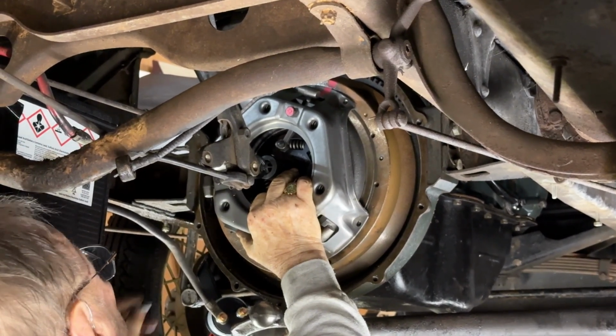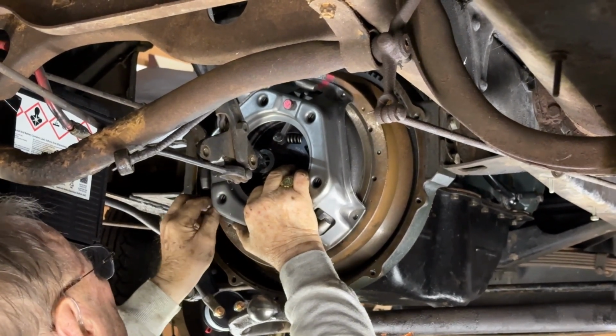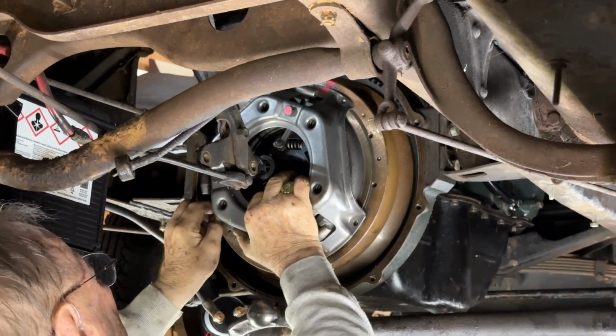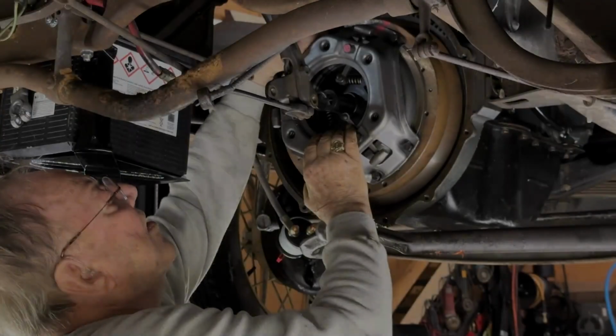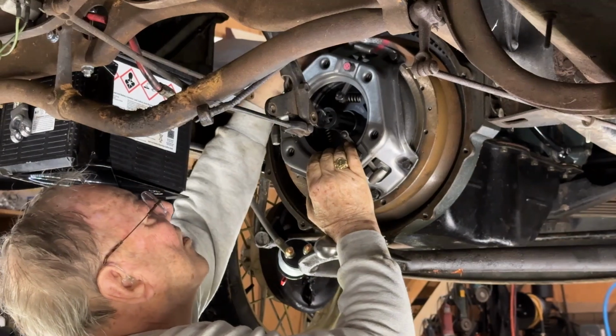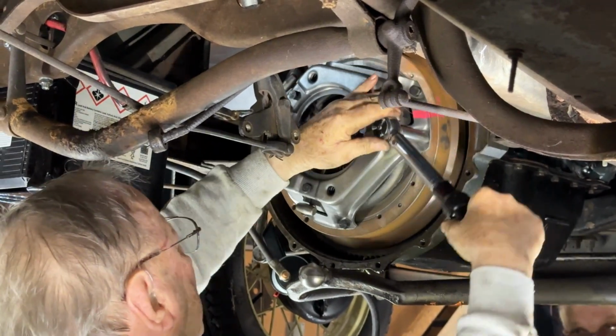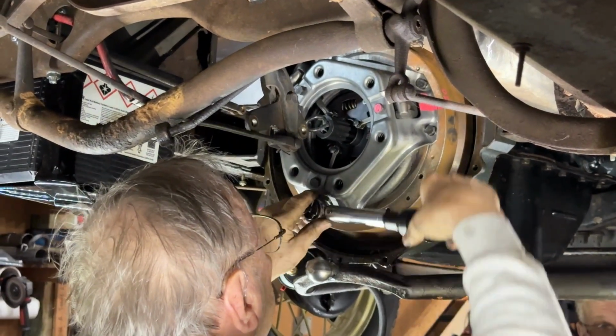Well, that makes sense then. That's the answer of why you have to get them together. They're balanced. So if you got your pressure plate together, it's the good stuff. But you can reuse the original flywheel and plate match with the pressure plate? Well, it already has a witness mark on it. And that's just beautiful because then you don't have to do anything.